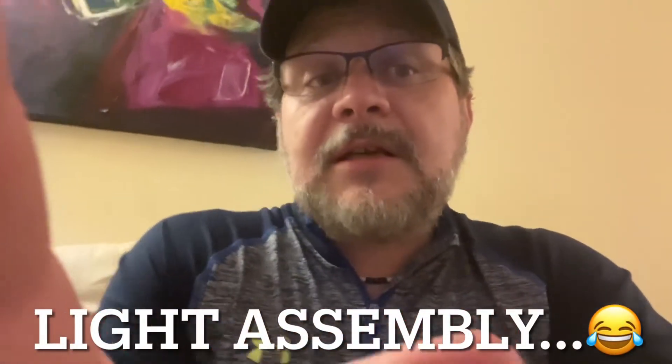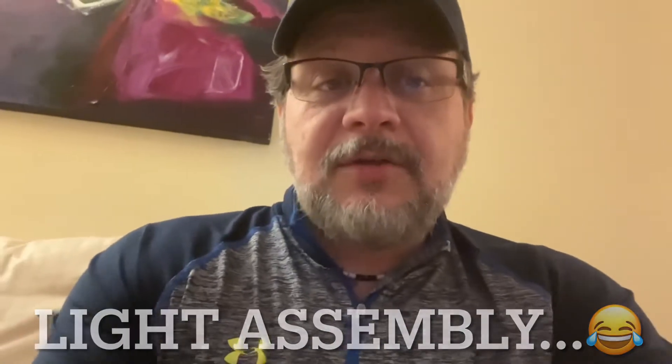So the point of this video is that you can take out the whole — this is the low beam, by the way — you'll take out the complete harness and I'll show you how to reuse the actual connector that's already there for the H11Bs, and use standard H11 bulbs, which is fantastic. Then you won't have to take out your harness because you'll easily be able to turn the bulb, pull it out, and the cable will be right there — just unplug the old one and plug in the new one.